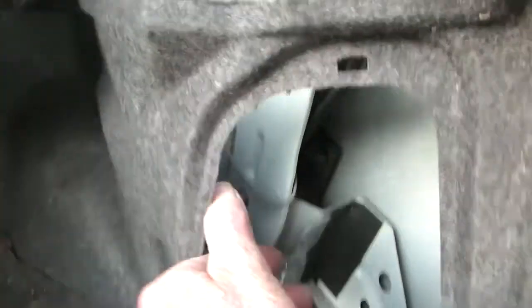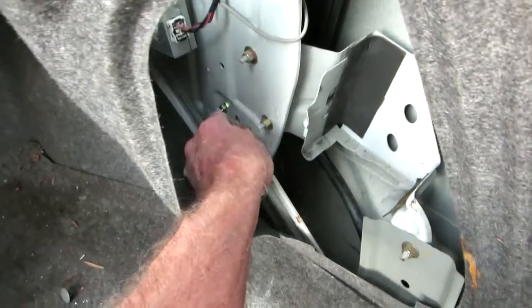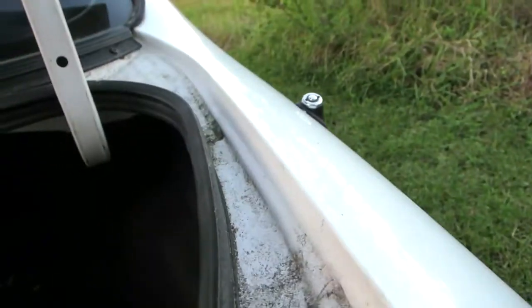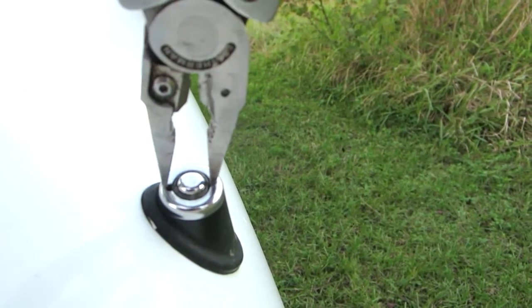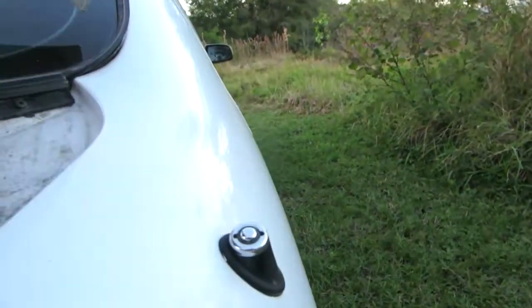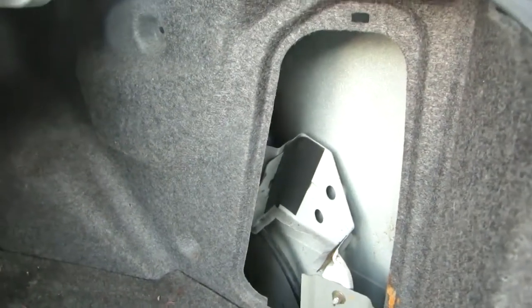It's going to come up through that hole. There are two 10-millimeter bolts that go in there. Make sure you don't pinch any wires. There's also an antenna booster wire that hangs over there. Put that little bracket together and there's a tube nut — in the best use of an improper tool ever, a little pair of needle nose pliers fits right into those two little spots and you can turn that nut in, piece of cake. Hold it up from inside with one hand, reach up under there, tighten this one snug first, then tighten up your 10-millimeter bolts.